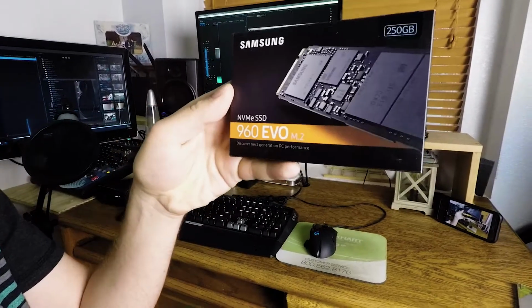So, some things happened. Ryzen came out the 6th. It's the 24th. Essentially, once I got everything put together and booted my hard drive, it worked. But only the first time. The Intel solid state that I had for my old build, only a year and a half old, didn't boot every other time. Most likely an issue with the BIOS, but thinking it was a hard drive, I ordered a Samsung NVMe M.2 solid state.